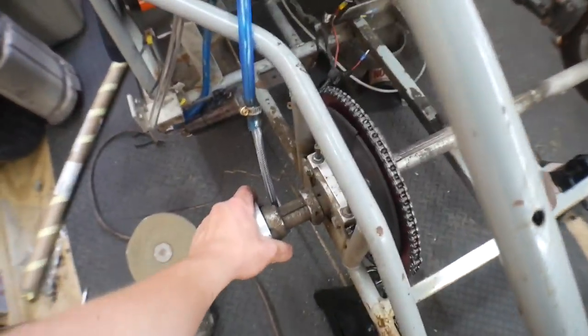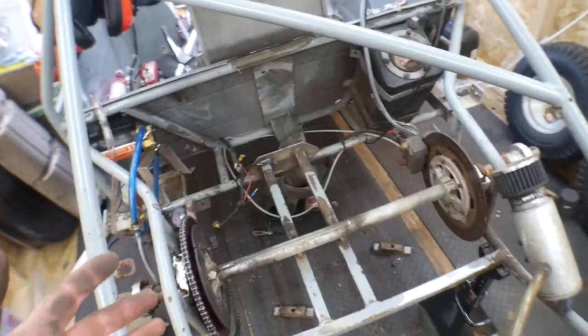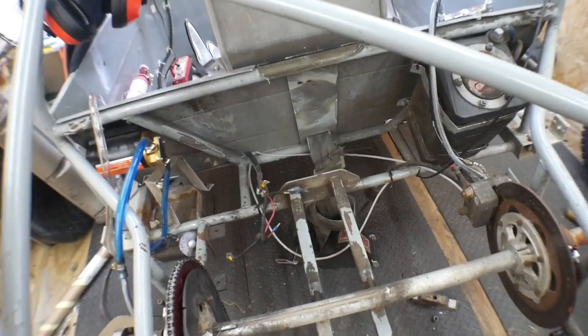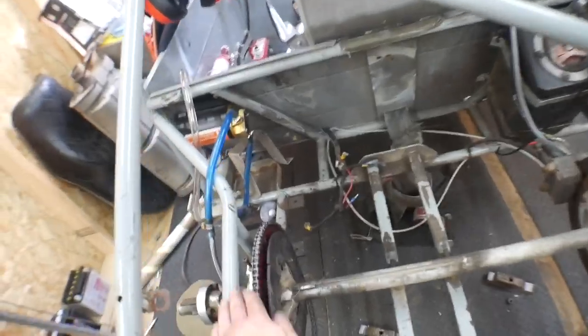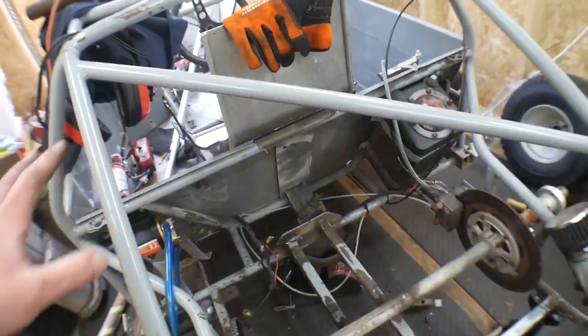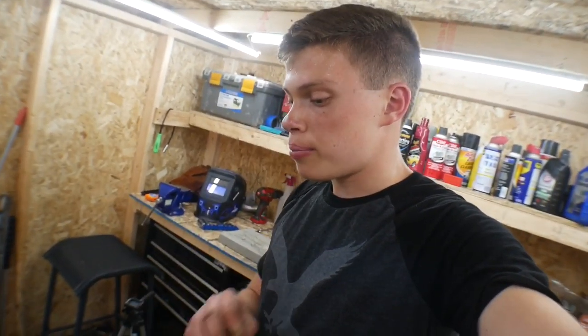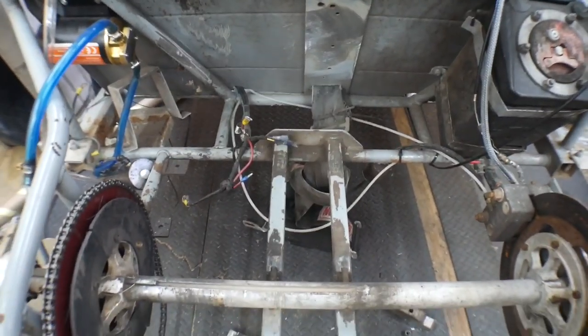I just finished tensioning the axle — that's all good to go. I also finished grinding some more on the paint; I forgot to press record on the time lapse, unfortunately. That probably won't be the last time I use the grinder because I'll need to do the other side with the upper engine mounts once I figure out exactly where I want them. Now I want to get the tape measure out and begin measuring precisely everything I need, then pull out the pipes and cut them to the angles I need for a flush connection.